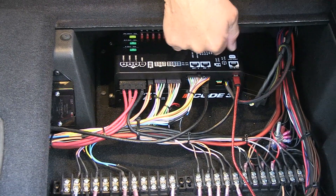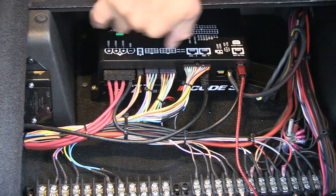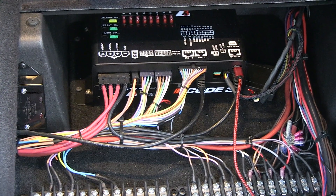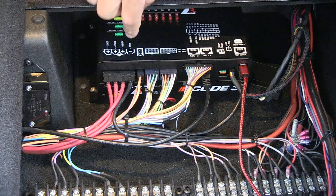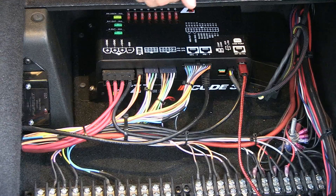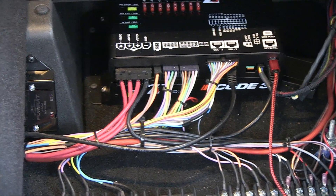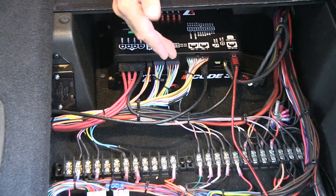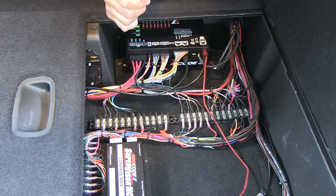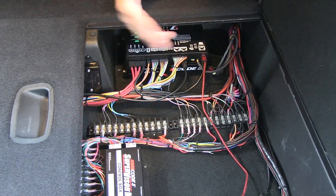And in that very rare case where something might go wrong, the nice thing is all of my fuses are right here on the top with an LED indicator. What the LED indicator allows you to do — if there is a fault in a fuse, that indicator light will illuminate red and you'll know you have a bad fuse. You don't really have to take out every fuse and inspect it — it does it for you. Your light bar connects through a Cat5 cable and then you're just running power and ground to the light bar.